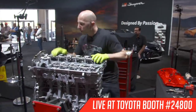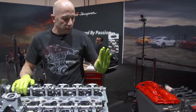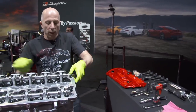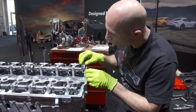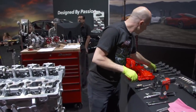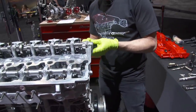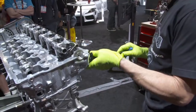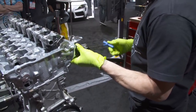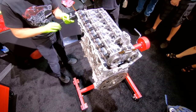Okay, we'll keep going. The next thing I'm going to do is put the last intake cam cap on. That one is the stop for the variable valve lift. This is the motor that controls the variable valve lift. We are still going to install it, but we're going to set the variable cam lift to maximum. Then we made a little lockout. You drop the tools, but don't drop the parts. And you can manually adjust it. So let me bolt this thing in.